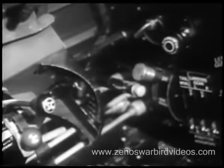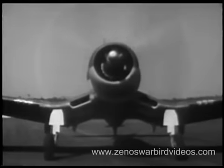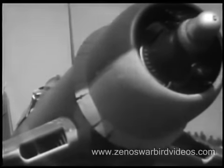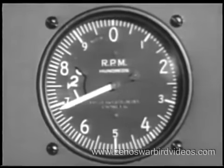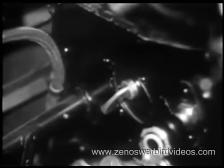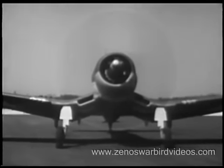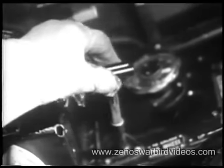We have a good runway at this field and this first take-off will be with flaps up. When the oil temperature is above 40 degrees and cylinder head temperatures are above 120 degrees, open up to about 30 inches in full low pitch. Check your mags fairly quickly — the drop shouldn't exceed 100 RPM and is usually between 50 and 75. Freedom from vibration is a good indication that the big engine is functioning properly. When you've gone through the check-off list and you're all set, lock the tail wheel and take off into the wind.